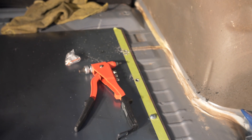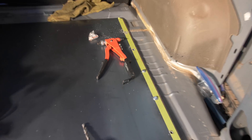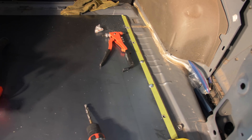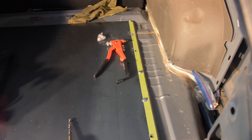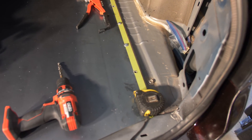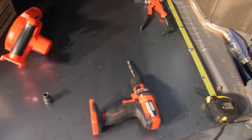So what you can see here is I have put some tape down, measured out how far apart I want to have all of the holes and nuts to secure it on the sides. I'm going to do that along both sides, and I might even do across the back and the front in one or two, just to be sure. We'll seam sealer it on the bottom side - it's not permanently in there like if we welded it, but it'll still be permanent enough that nothing can get through. So seam sealer, Sikaflex, bolt all this down, then bolt in the RHS and put the fuel cell on top.